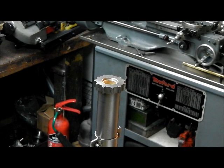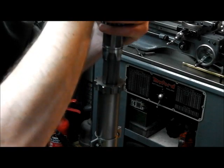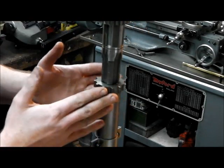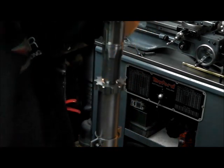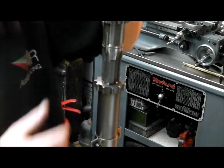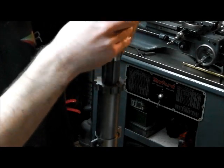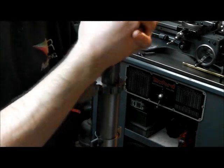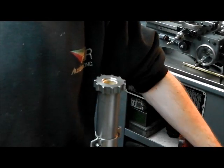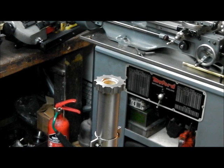So that's the bush pressed further into the shaft about an eighth of an inch, which is about right. I couldn't find a measurement for that in the book, but basically as I described it just needs to allow the rear output shaft right up to the front output shaft, which in reality won't happen because the bearings hold it. You can see the line where the bush has been running, so there's again about an eighth of an inch gap but it means there's no foul up with the bush there. I don't think we'll actually need to ream this so I'll measure it and find out, but the last one of these I did I had to ream the bush, so it's somewhat easier this time.